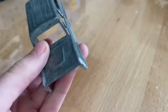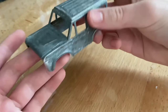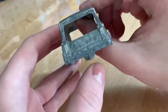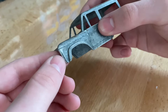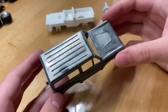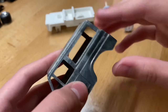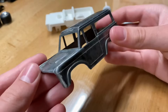Now I've done a lot of grinding using just this old grinding wheel on my Dremel and filing and sandpaper all over the body of this Ford Bronco. I've definitely cleaned up a lot of the dents and imperfections in the front, around the sides, and the imperfections back here too. As you can see there's a lot of toning and stuff on the metal - after one or two coats of primer this will start looking a lot better. But what I need to do first is fill in this area here and a few more dents, definitely remove the rust. After applying a couple more coats of putty and sanding down the Bronco, here's how it looks. It's all filled in there on the top and on the side. I also tried to repair as good as I could the imperfections all in the front. There are a few little more things I need to fix but otherwise the Bronco body is about ready for primer.